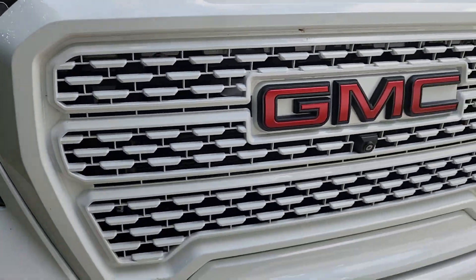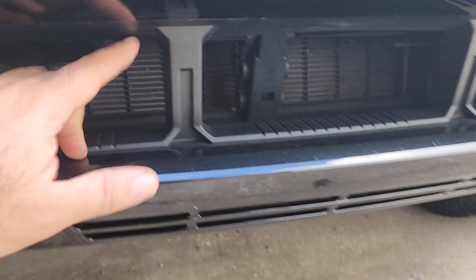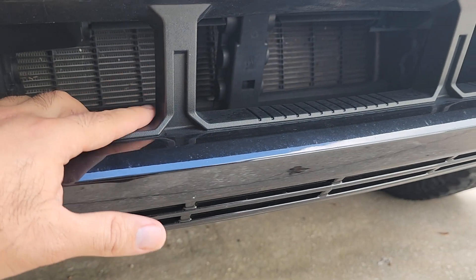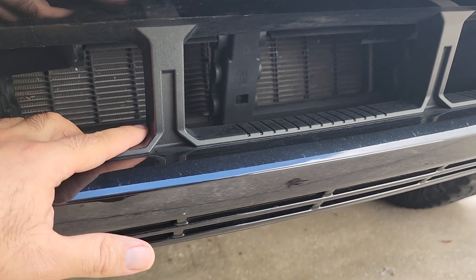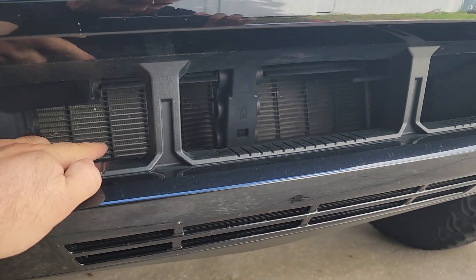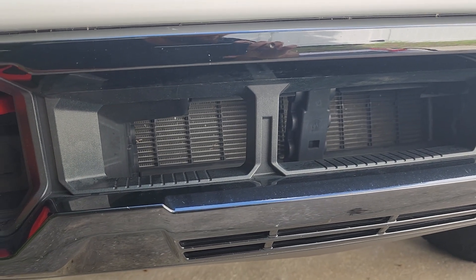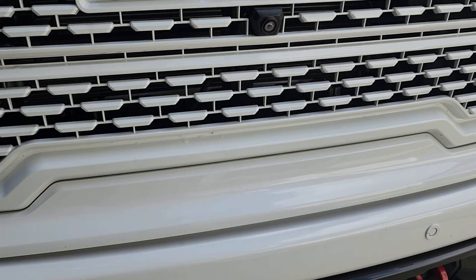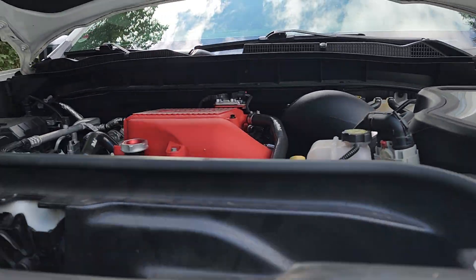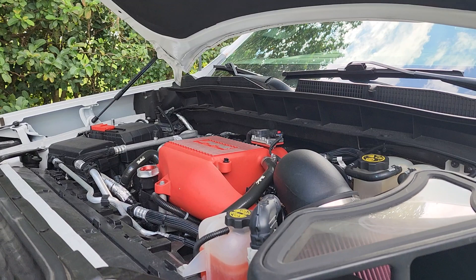In my opinion, the manufacturer leaves a lot to be desired, so I'd rather do my own modifications. I do believe Addictive Desert Design has a bracket that eliminates this whole system but allows the motor to go through its range of motion without setting a DTC. I know of somebody else working on something similar — mainly needed for aftermarket bumpers where you don't want the active grille shutters anyway. Let me know in the comments if you agree or have a different opinion. I definitely have more content on the way for this truck — thanks for watching, please like and subscribe.